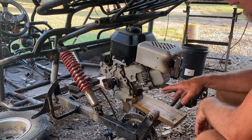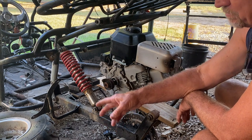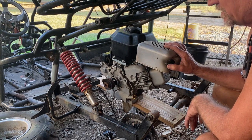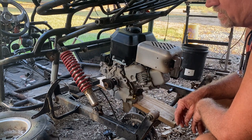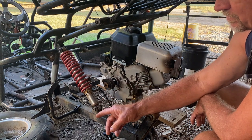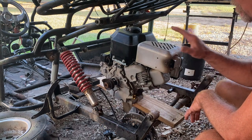I can never get a true answer on how well these small engines with the big sprocket and torque converter will pull these tires on back - they're 22 by 10 by 10s. But if you measure the height of the tire they only measure like 20 inches tall. If this motor doesn't have enough torque, one thing I could do is go to a smaller back tire. Even if they make an 18-inch tire and it measures 16, that's four inches different - that makes a lot of difference in torque.